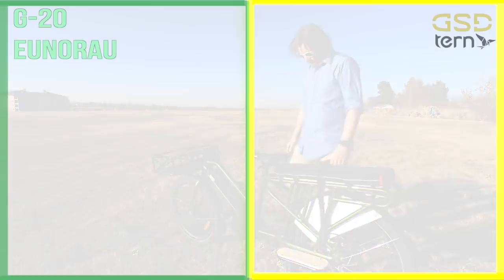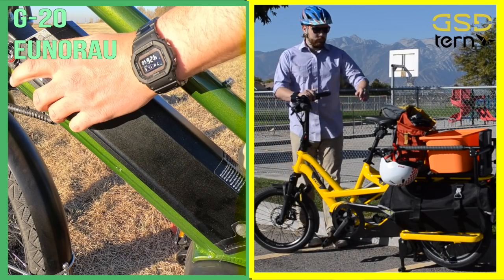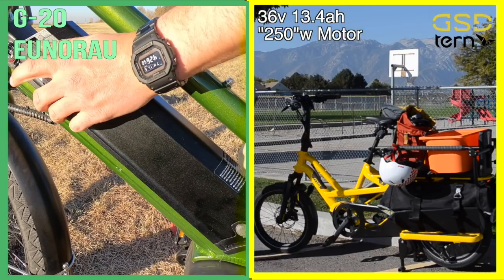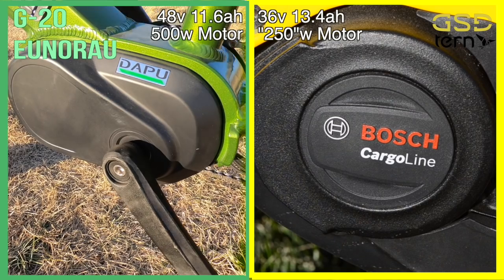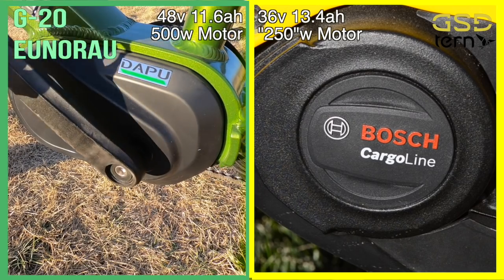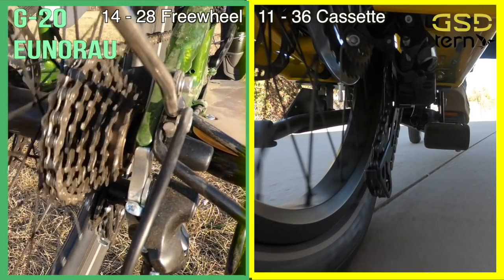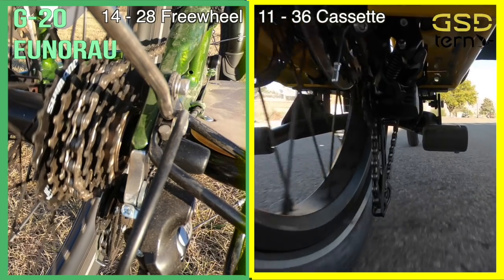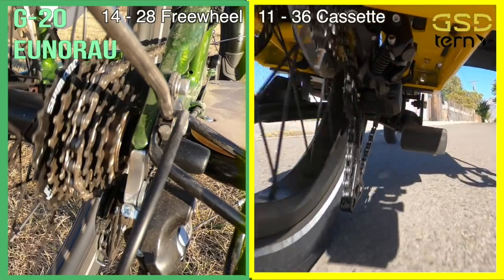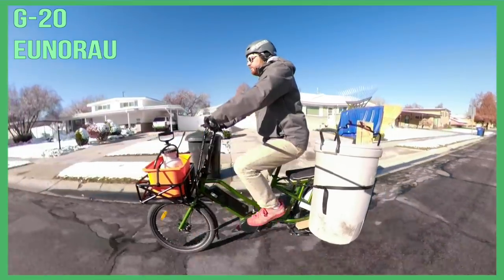Let's make a hard turn and talk about some comparisons. Going back to the battery — the Tern GSD uses a 36-volt Bosch system, which is a little tugboat powerhouse. The G20, on the other hand, has a 48-volt battery going through a motor that's not quite as refined or powerful. The numbers do lie in this case: the G20 motor is forced to interface with a paltry freewheel in the back, only offering a range of just 14 to 28 teeth. This means the bike is mechanically constrained both in speed and low-end torque. Speed I'm not worried about on a cargo bike, but low-end torque is a must-have for cargo bikes that do heavy lifting — and therein lies the heart of the issue.